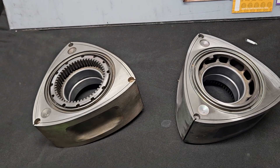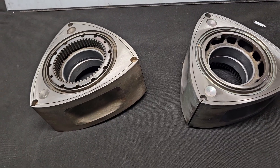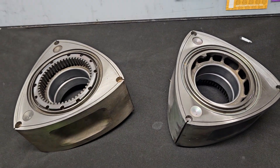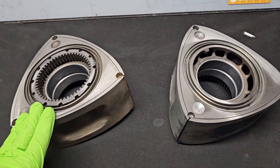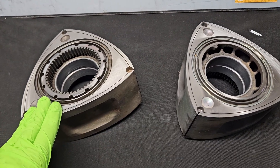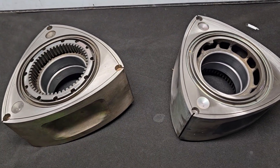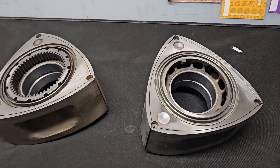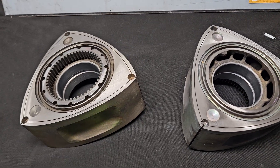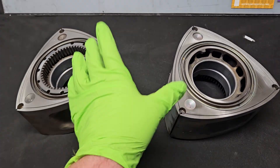You don't have to go crazy overboard with your build to increase boost levels or increase RPM. Basic things like balancing and proper tip clearancing and matching of rotors can achieve some amazing things. Packages just like this can get up into the 9,000 to 9,500 RPM range. We've even used rotors exactly like this in my thousand horsepower drift motors and they have worked perfectly well. I always recommend deciding what your RPM goals, horsepower goals, and boost level goals are, and then it's really possible to build an internal package to suit those needs.